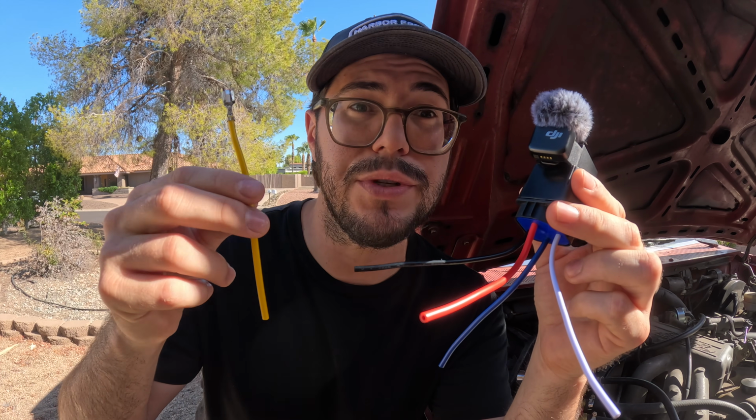And that's only half of the project done, but already we're seeing some improvement from our fan. And now we can get done with the easy side. Now that we're relay pros, this next part of the install is going to be really fast. We're going to be using the same style of relay, but I depinned the yellow wire because we're not going to be using it for the voltage side.